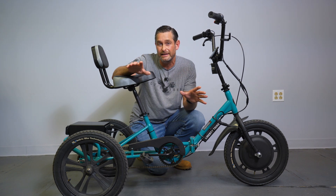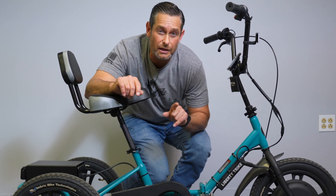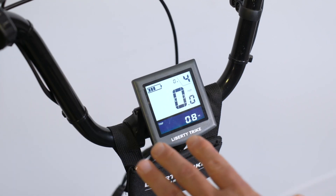This will make a whole lot more sense by the end of this video. First and foremost, I want to talk about voltage sag. Voltage sag is something that happens to every battery when it's put under load or pressure. So when you turn that throttle on a steep hill and put a lot of pressure, you're going to have voltage sag — the voltage is going to dip down under pressure. So first we're going to show the voltage sag.